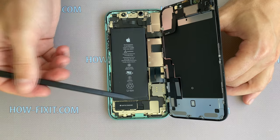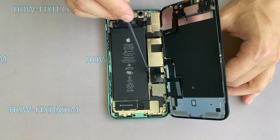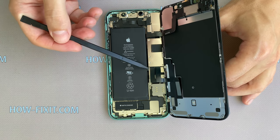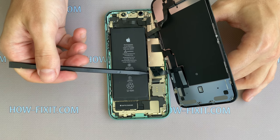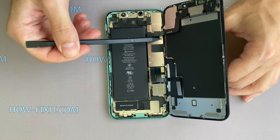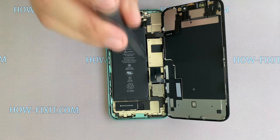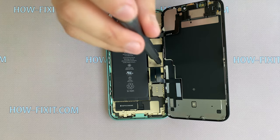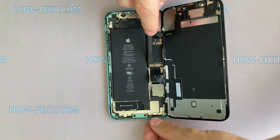First, you need to disconnect the battery cable, but in iPhone 11 it's located under the metal panel, which holds 3 screws, and one of the screws is hard to reach. It's under the cable of the display module. So, in order not to break the display cable, first remove 5 screws on the large panel, then disconnect 3 cables of the display. When the battery is connected to the mainboard, it's not critical to disconnect the display module, because the most important thing is to disconnect the battery when you're connecting any module.